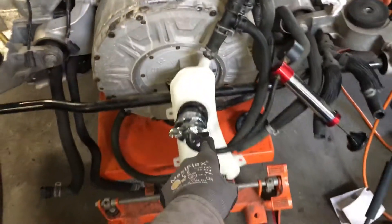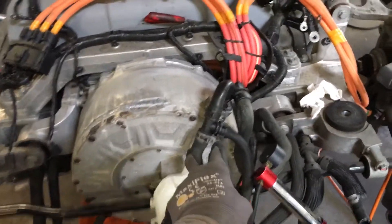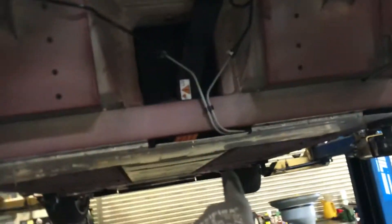This one is being pressure tested. Here's part of the cooling system that goes to the air conditioning. On this one, we're cooling the water for the case but also cooling the water for the hybrid battery — that big black rectangle that goes throughout the car, all the way down here. This is all a giant battery pack, and this battery pack is also cooled. You can't see the hoses off of this plate heat exchanger.